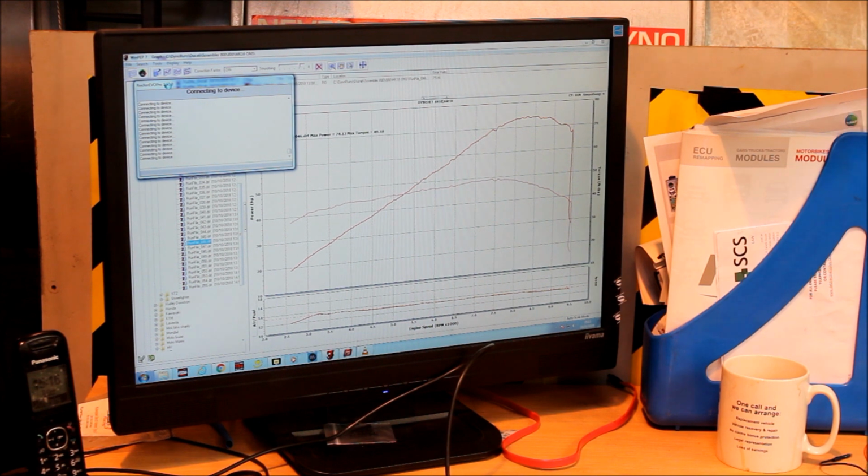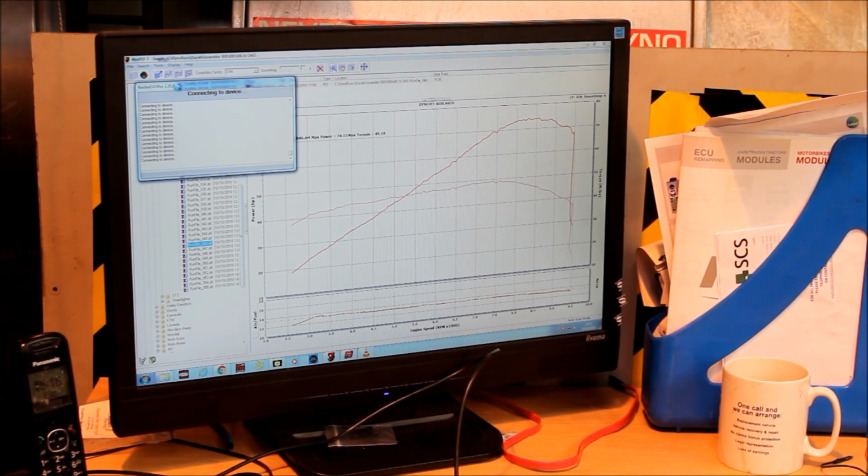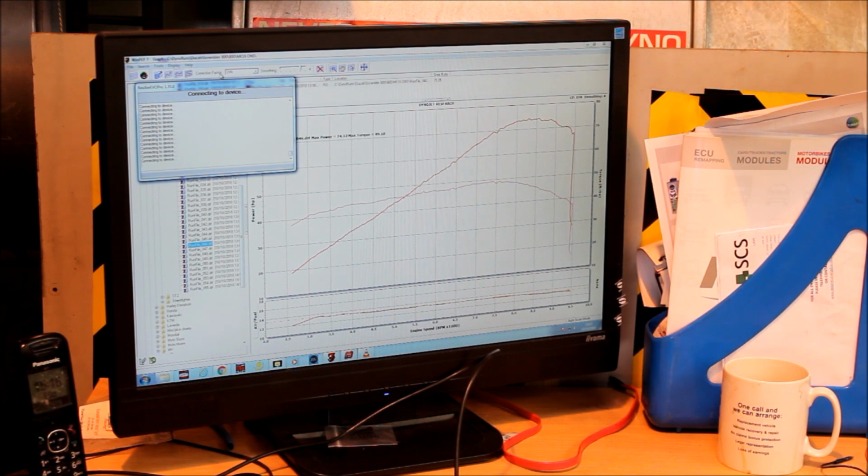Okay, Sam, so we're now looking at the output of this Scrambler that we just watched on the dyno, a Ducati Scrambler, Euro 3 model. That makes a difference. Euro 4s get the same sort of results. This is now finished mapping on 100% throttle. I'm happy with that result. We're looking at 74, 75 horsepower from just about 70 at the wheel.